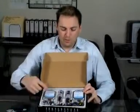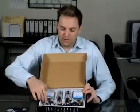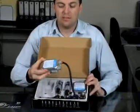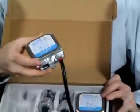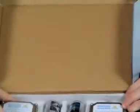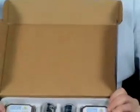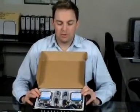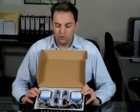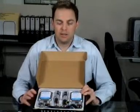It comes with 2 ballasts and 2 globes. The ballasts are the standard size ballast. You can see it's roughly the same size as a packet of cigarettes. The ballasts are responsible for taking your 12 volts from the halogen system and stepping up to 23,000 volts initially to fire the globes. Once they're going, it drops the current down to about 80 volts and keeps it steady around 80 volts.